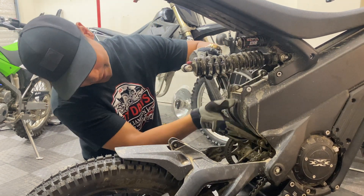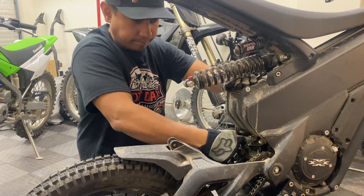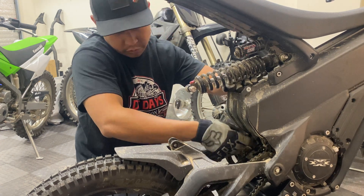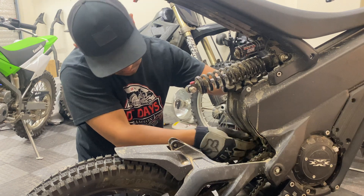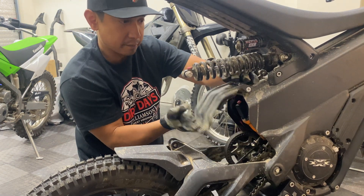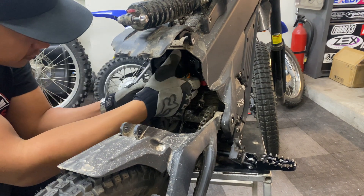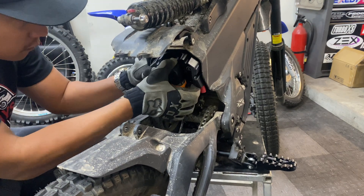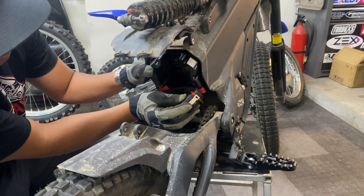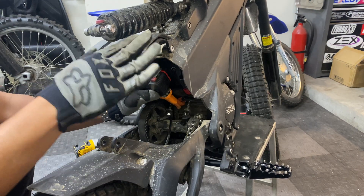I really need to clean this bike. Pop the cover off — you're going to release these two levers. You pull the levers out and then start turning them counterclockwise once you release the tension. Just like that, you have access to the battery. This is actually my first time taking a peek at this battery; I haven't had a reason to disconnect it. You just press down on the red portion of the top clip and wiggle it out. I'm not going to pull the battery out — I just want to disconnect it for the install, so I'm going to leave this hanging.